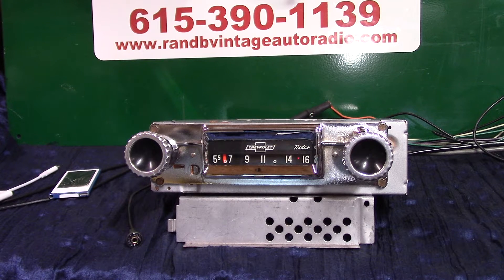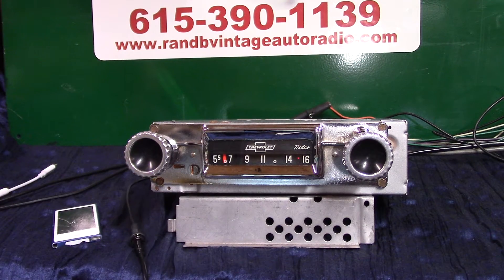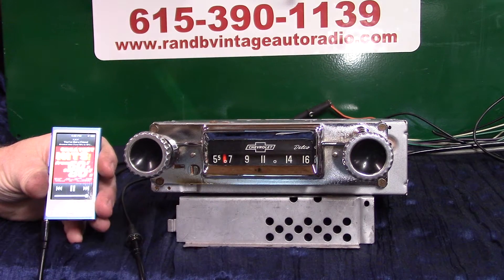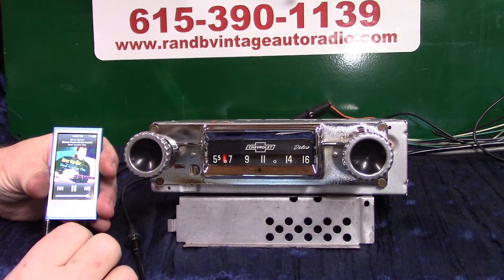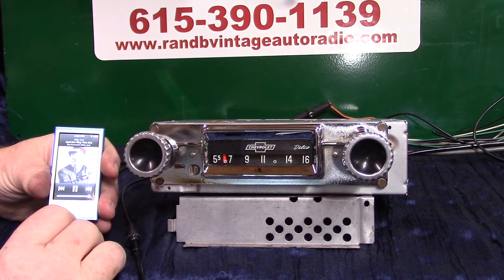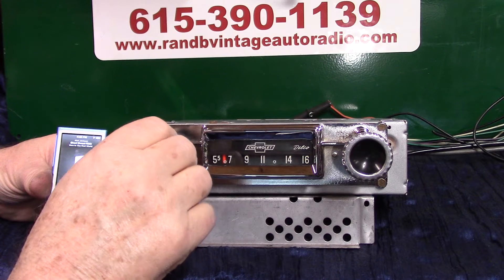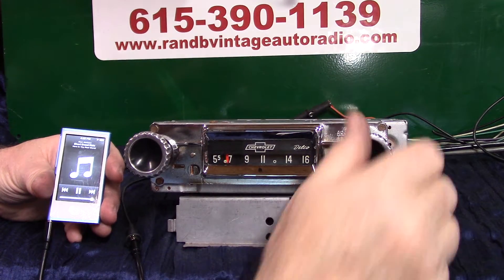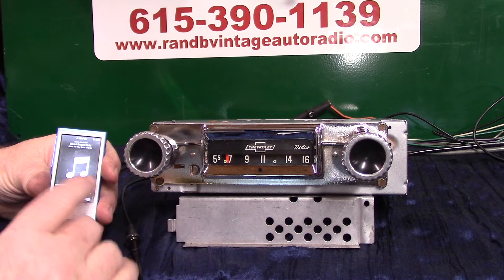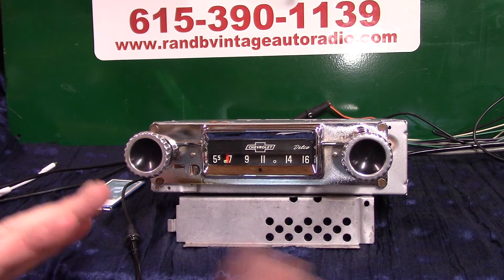Now you can take your iPod, or your phone, or your CD changers, or anything that's got a headphone out that puts out music. We've got a little MP3 player — plug it in, and the radio will automatically transfer over to it. Bring it up, hit play. And if you notice, right behind this needle, the light has gone to green — that means you're on auxiliary in. Anytime you want to go back to radio, all you've got to do is turn that device off. In 20 seconds, if you don't touch the radio, it'll automatically switch back over. But if you want to shorten that 20 seconds, just turn it off and back on.